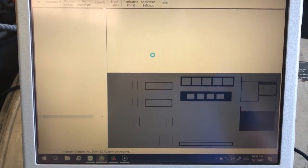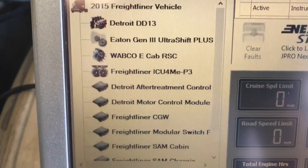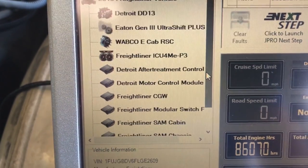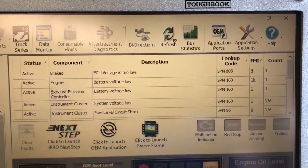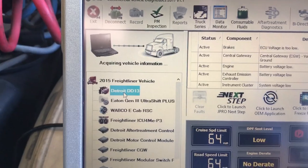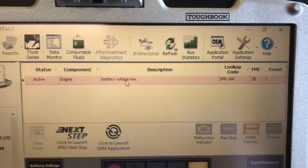We're already communicating — it's starting to populate. As you can see on the left, it's already found all the different modules on this particular vehicle. They're nice, clear, and easy to use. Up here we have all of our codes. If we go on the left and pick Detroit, it'll filter the list down to only engine repair information.